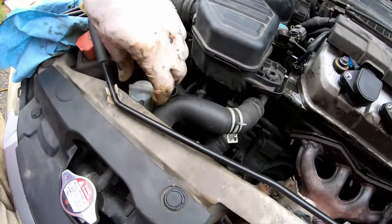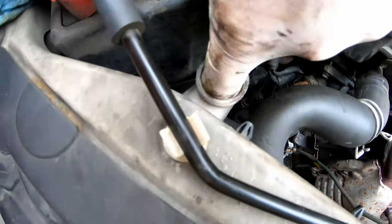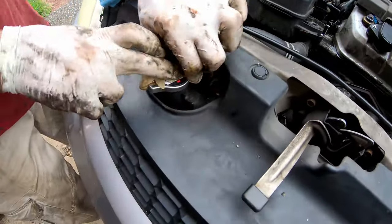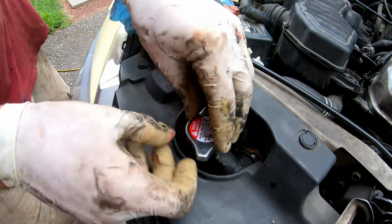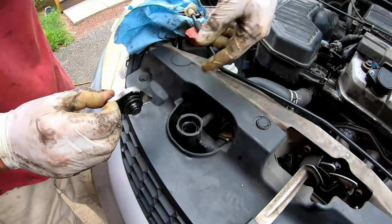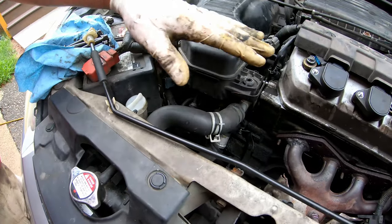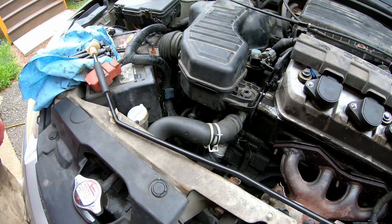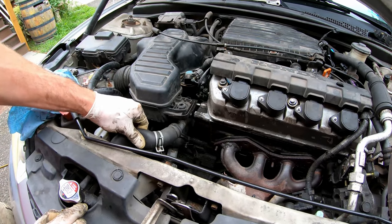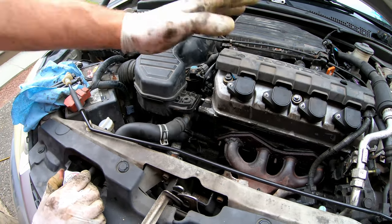The problem was it kept overheating. A few telltale signs of a blown head gasket: check your coolant overflow tank — if you see black sludge in there, that's an indication combustion gases are getting into your cooling system. Pop your radiator cap off; if it's all sludged up and melted, same thing. Another quick check: top off with water or antifreeze, put the cap on when the engine's cold, start the engine and rev it a couple times for 10-15 seconds, then shut it off. If you squeeze the upper hose and it has pressure, or you relieve the radiator cap and find pressure, that's a strong indicator of a blown head gasket.